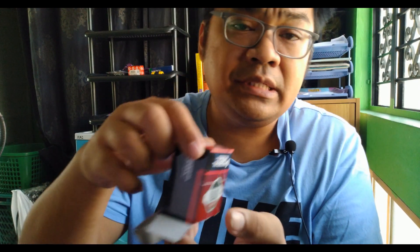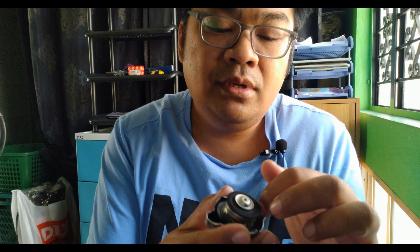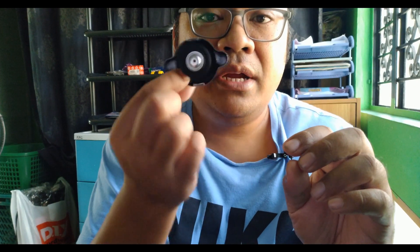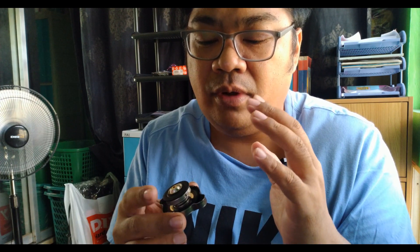Let's go ahead and open this one. So this is actually my original radiator cap from my Ion. Let's quickly go through the parts of the radiator cap. We have two sealing rubbers — you can see this one and this one — and there is a vacuum valve, which is this, and a spring-operated pressure valve, which is this.